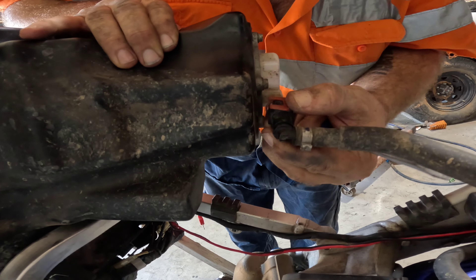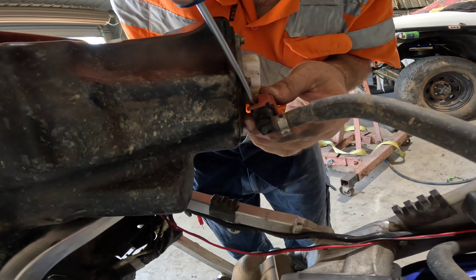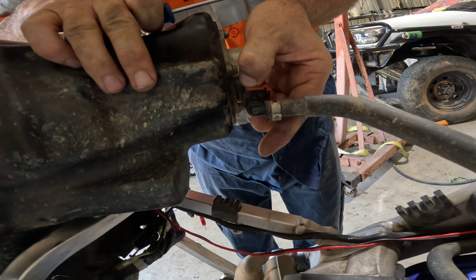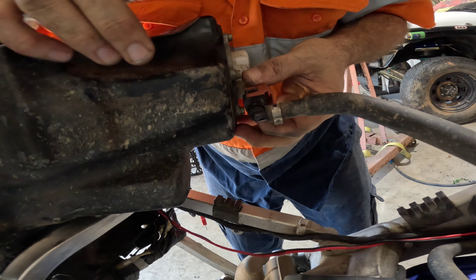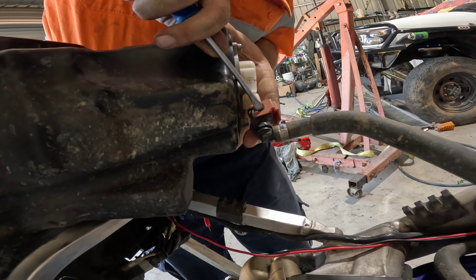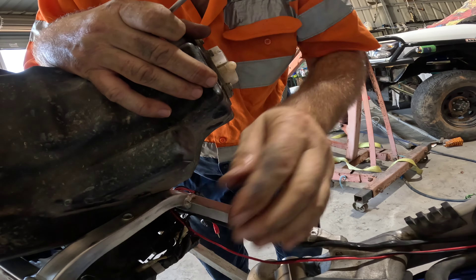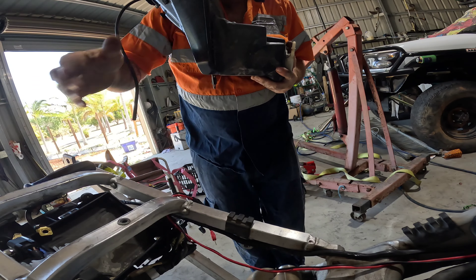You've got plenty of room in here to move. Around here you've got this little bit - fuel's probably going to come out because I didn't get it all. Just get your screwdriver on there, push it in, take that off. It's that thing either side - put a bit of pressure on it, come from this way. It should just pop straight off. There you go - it's coming off now. Squeeze both sides of that, pull it, and the fuel's going to probably come out so I'm just going to tilt it up. Not much. You've got plenty of room with this cord. You do have that little lip you've got to get it over. That's pretty much the first bit - how to get the tank off.